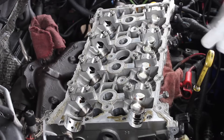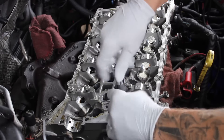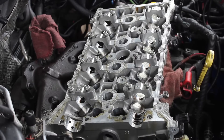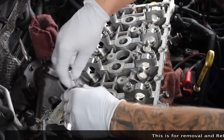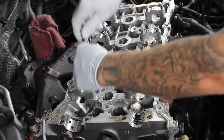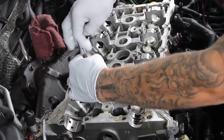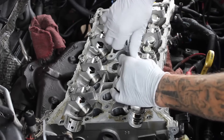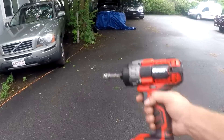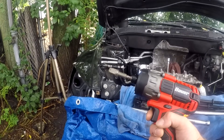I'm going to put my gloves on and go ahead and take out my 10 head bolts — they're already loose. I'll use my T55 long. Shoutout to Sam Leiter, another Caliber SRT4 owner from New Jersey, for messaging me and telling me I needed the T55 long neck. Today is the day — I'm taking my head off to bring it down to the machine shop. I had to go get my new impact tool, but it'll make this job go a little faster.